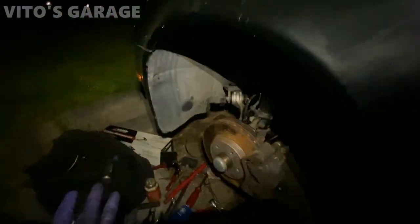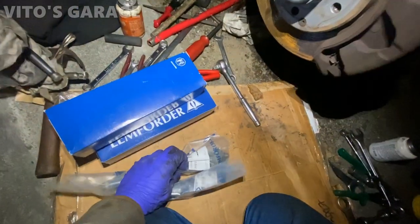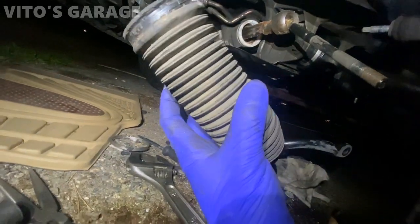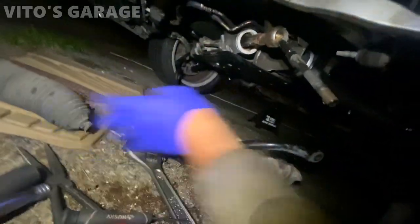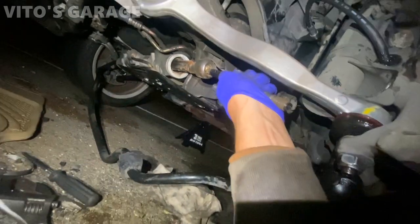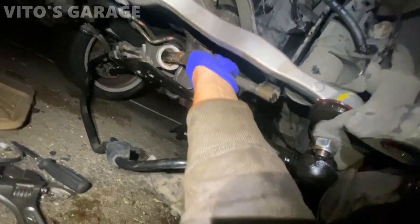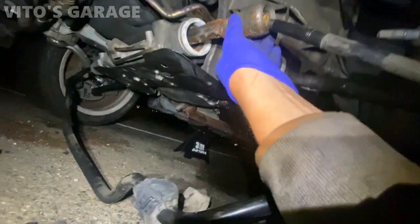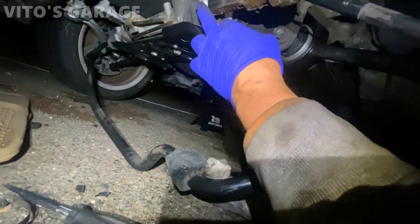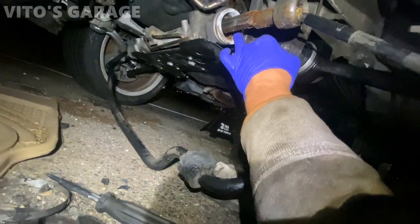Now I'll be working on the steering system of this car. We've got the inner tie rods and outer tie rods in there. I just got this boot off and clamps. It's the tie rod - it actually has some play. This whole area does not look the best, so I've got to clean this. Look at this corrosion - that's crazy.